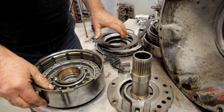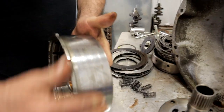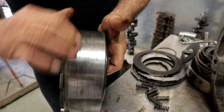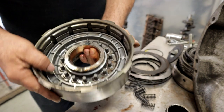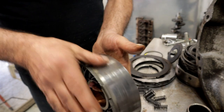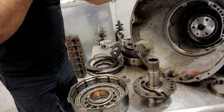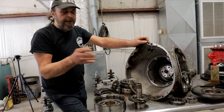That's also why, when you have one of these things apart, it's important to inspect it everywhere. You want to make sure there are no cracks, no defects, no deformities anywhere in it — any blue spots that would show concentrated heat. You really want to look these things over. This one looked okay; I looked it over last night and I'm confident it'll be fine to reinstall. On the rear clutch, everything was hunky dory as expected.